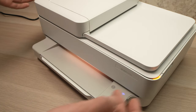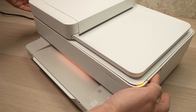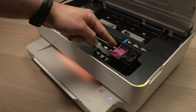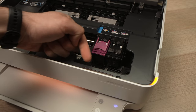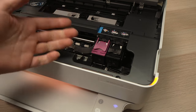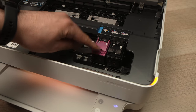The first thing you need to do is on each side of the printer there are these small gaps — you need to lift this lid and wait for the cartridges to be presented to you. You'll see there are two lights, and if one of them is flashing — in my case it's the left one — it indicates that there is a problem with the ink cartridge on the left.